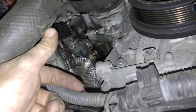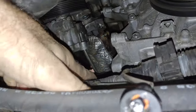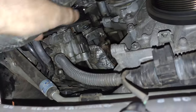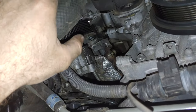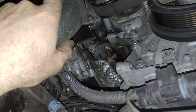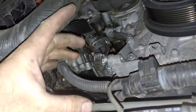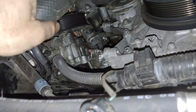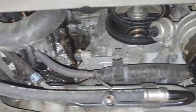Push the lines down about like that and they'll pull out, then you can squeeze the alternator out this way. It first hits this and this, so put this down underneath the alternator. Be careful because what's mainly going to be hitting is the alternator stud — kind of squeeze it out of the way and make sure you don't rip it with the stud. Don't he-man it out, be gentle, and once you get that stud past, the alternator will literally just come right out of that hole.